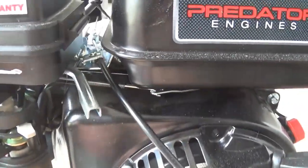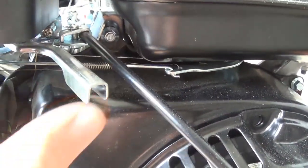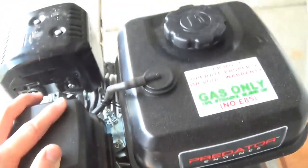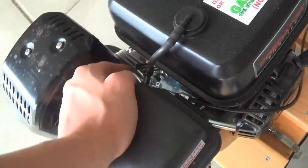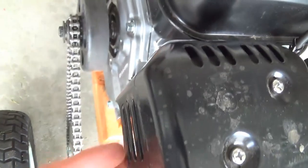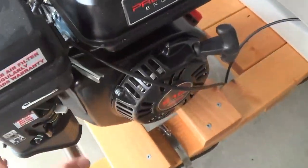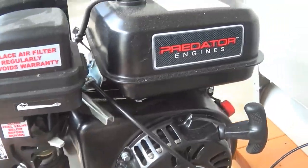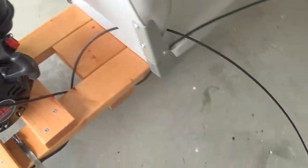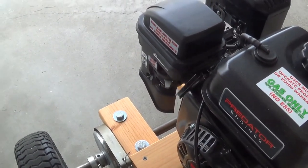When this cable is pulled, that's your gas input. There are return springs on the engine already, and as you can see it snaps back very well. Some people like to add an extra spring and drill a small hole to wrap one around, but I haven't had any issue with the throttle not returning. You can do it as a safety precaution, but in my experience it hasn't been necessary.